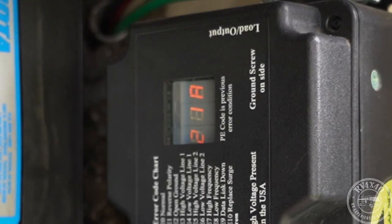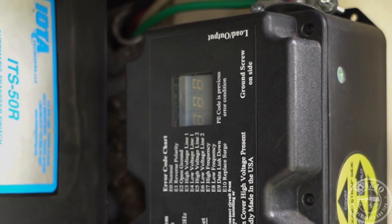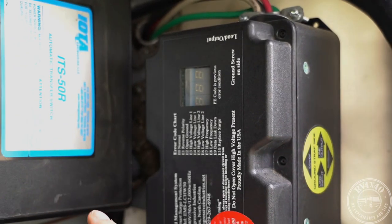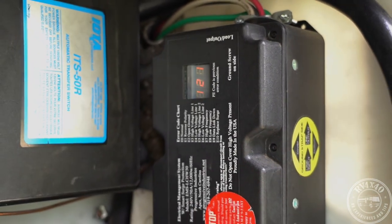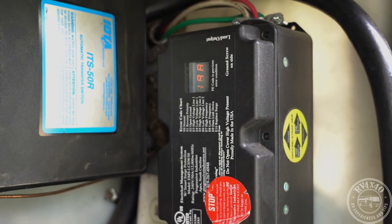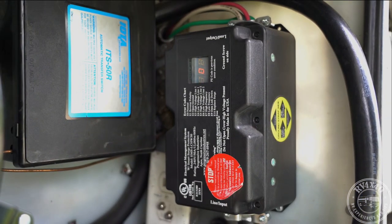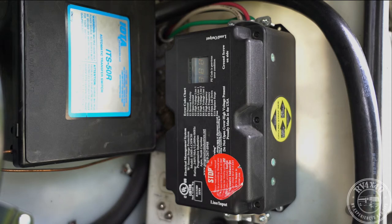As things start kicking in, you can see the current going up and the voltage dropping slightly — still 60 hertz, still no errors. Line one is now at 120 volts, pulling 21 amps, most likely because the battery charger has kicked in since power was off. Over on the left you can see our transfer switch — it's been there since the coach was built. It's a brand known to have problems, IOTA, though this particular one works fine. This is a Progressive Industries system, hardwired in, with power from the transfer switch going out into the RV.